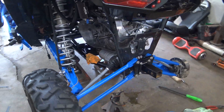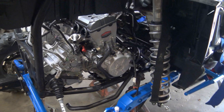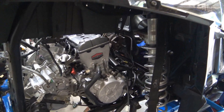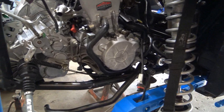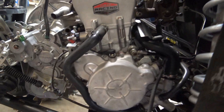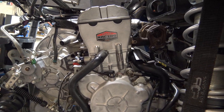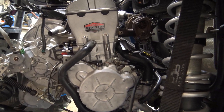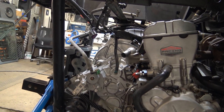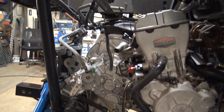Trans is aligned, got the turbo going on now. I had to align the turbo into the exhaust housing because I swapped housings, but everything is looking good. I still got to tighten up the exhaust manifold, then I'm going to start getting my heater hoses on and start buttoning up some more wiring. All this wiring is kind of laying here until the intake manifold gets in.